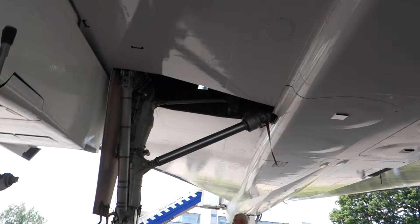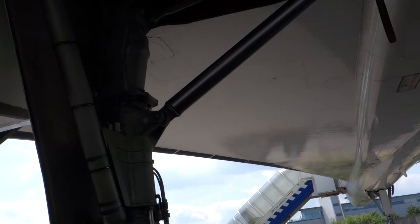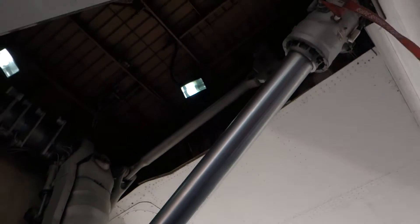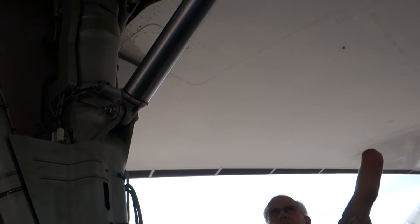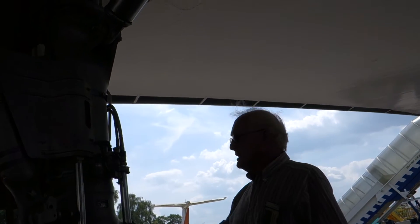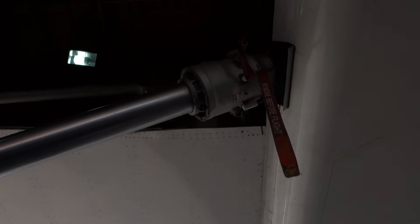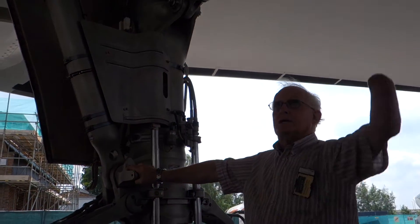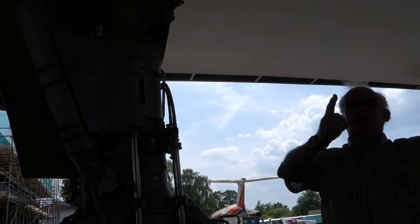This undercarriage is too tall to go inside these bays. Up here there are two bays which open to the centre line. When you're off the ground you select up. Those will normally retract, but this one shortens itself, so this bit disappears inside here, and it thus reduces the length going into that undercarriage bay. When you've selected up, the doors obviously open, and this will go inside there. This is connected to the up lock when it's in that bay, and once it's gone in there it will trip that up lock and close the door.